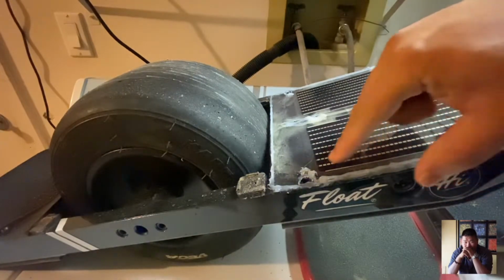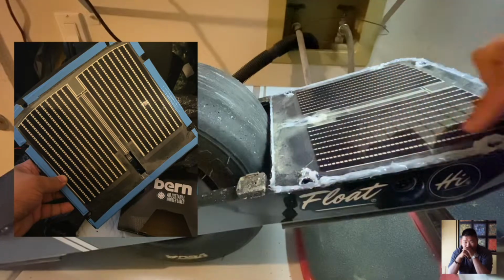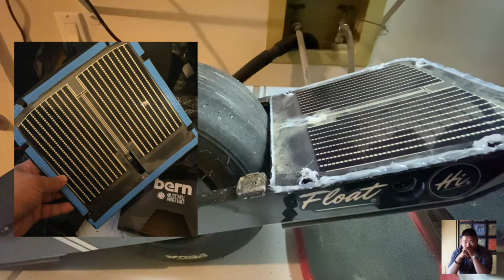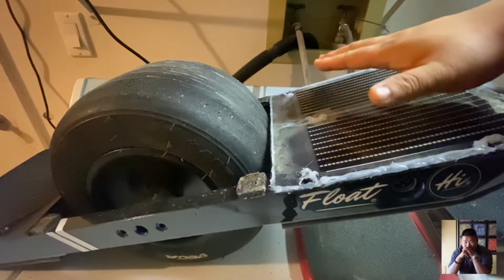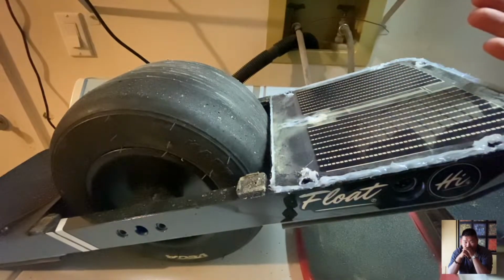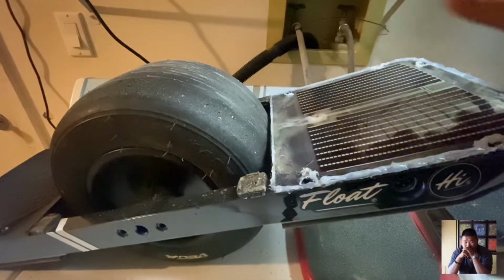So in the previous iteration, along here, to tape up the edges, I used a double-sided tape. It was like double-sided duct tape, and I put two layers on. What I found was that for a normal heel lift, it was fine, but when riding the XR on my daily commute, I essentially ghosted and had runaway boards if I tried a variation of the quick stop, taking my foot completely off the sensor. When that happened, it didn't spring back fast enough, so it just thought my foot was still there on the foot pad and it would keep running.